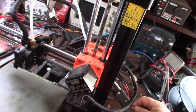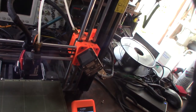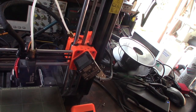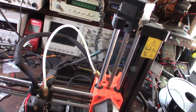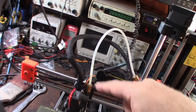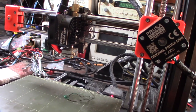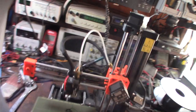Let's try this again — it's not grabbing. I had to push it a little with my hand. Now I have to load this again. Load filament — PLA, continue. There it goes, you can see it coming through! We've got temperature, purging looks good. That means they purged out the rest of the green filament that was in there.